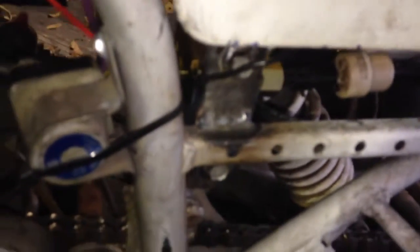So then I went riding and rode about a half mile and it just stalled out, literally. I was able to blow into the gas tank here, blow into the cap, pressurize it, and get fuel into the float bowls - I could hear it getting in - but the pump wasn't doing anything. So I got back home, barely, after doing that like 15 times, stopping and repurging and everything.